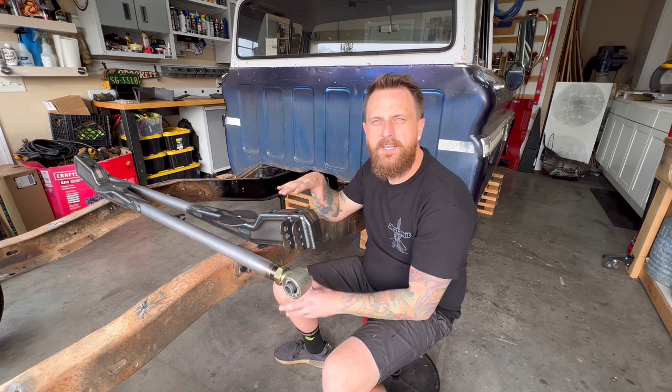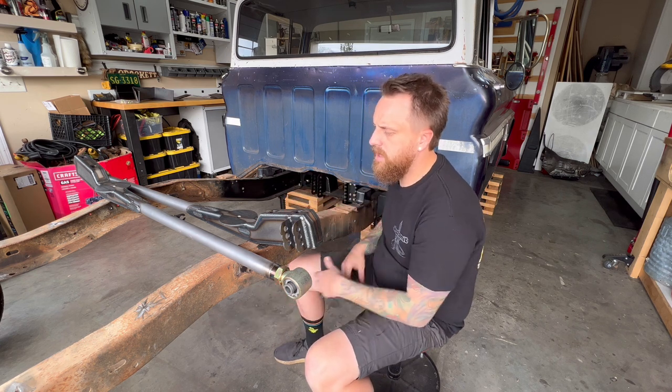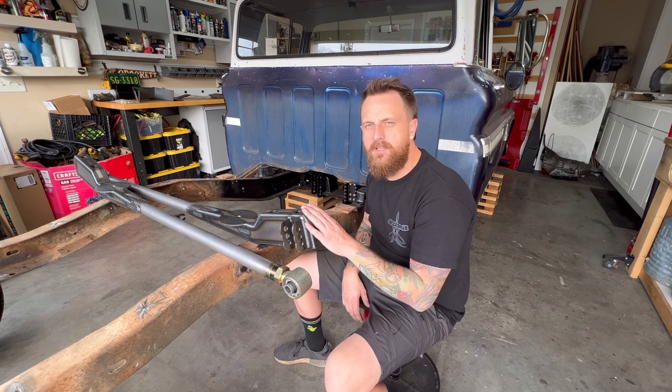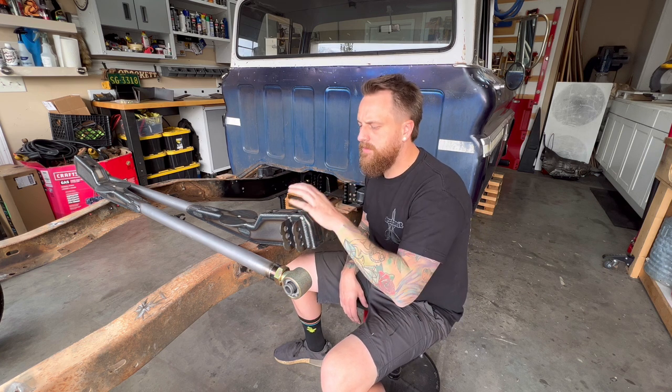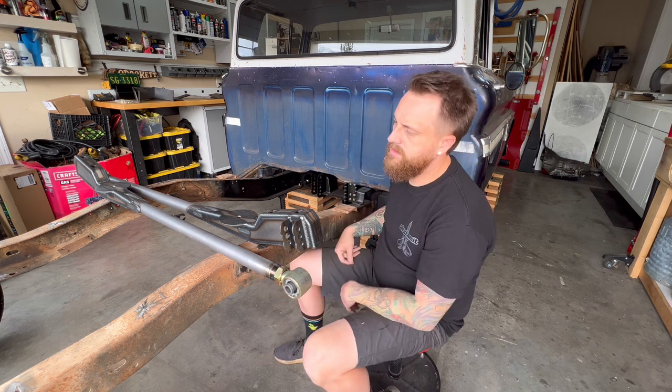So let's go ahead and get a flat disc on the grinder, get the frame cleaned up everywhere the notch is gonna be. Bolt in our trailing arms, put the block in there and bolt in the rear end. Jack up the rear end and mark our center.